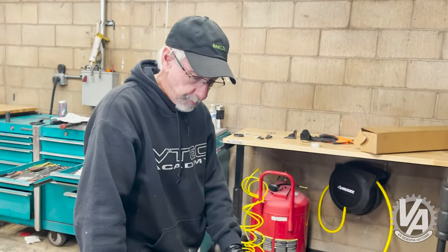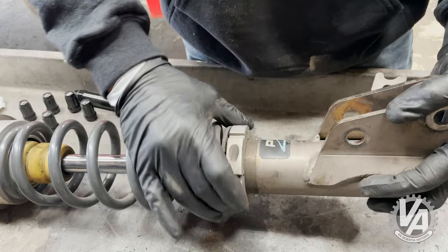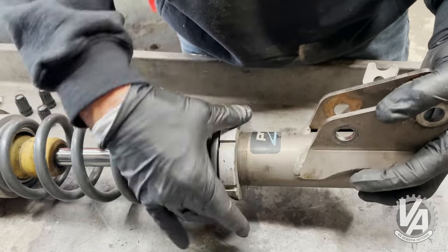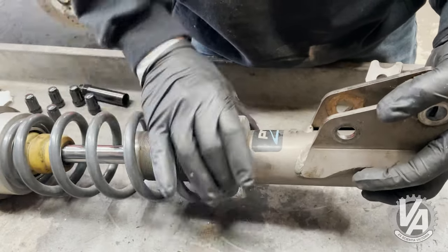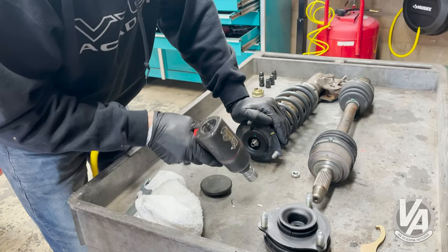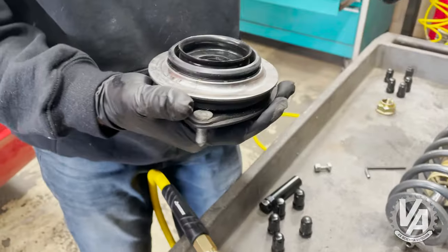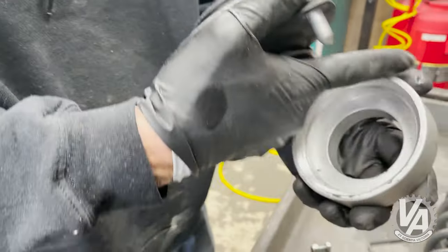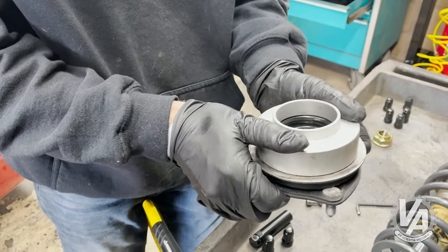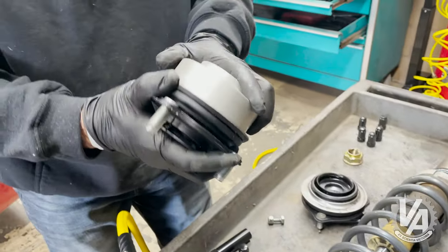You want to go down four turns total, which is fine. One, two, three, four. So clearly this is machined to seat and not rock. That should be fine. Let's just try it again with the new strut top and see if the noise is not from rocking.